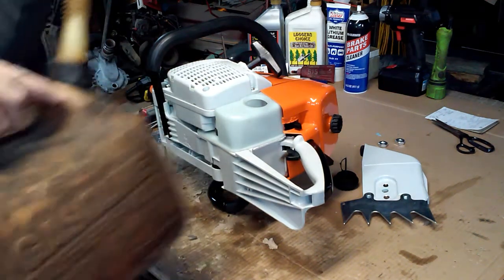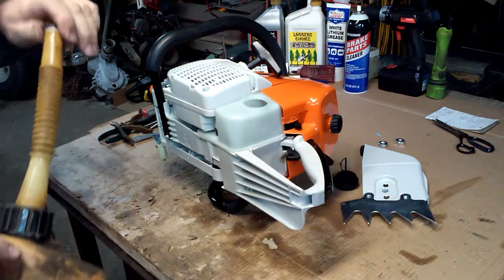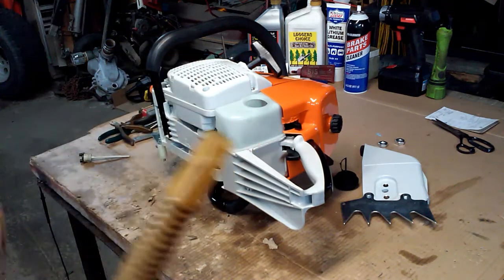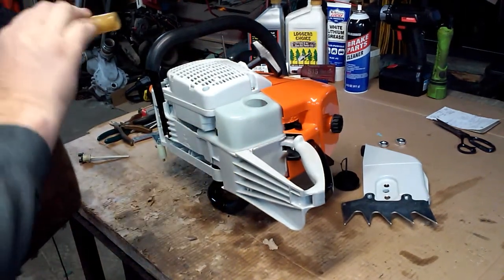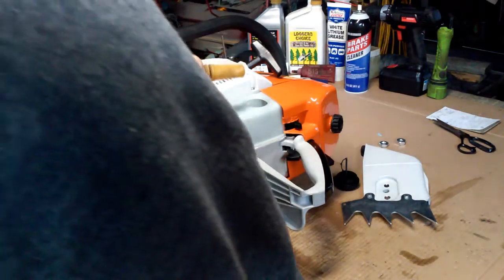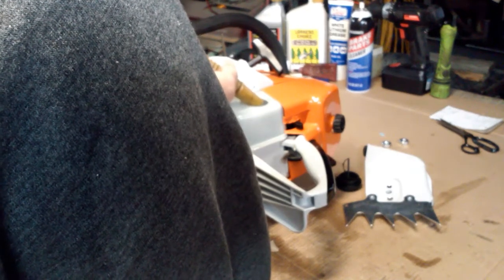Shake your gas up, especially if you use anything that's got E10, not E85, but ethanol in it, excuse me. The water can separate and go to the bottom. This is my 32-to-1 oil mix. Everything that I run, I run 32-to-1 in. I'll sacrifice a little oil coming out the exhaust and some fouled spark plugs to keep from burning the cylinder out.